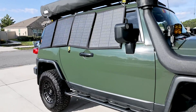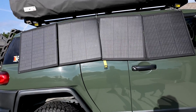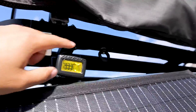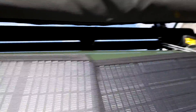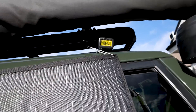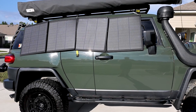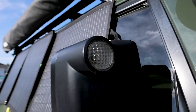In case you don't want to put your solar panel on the ground — it may be very wet, dirty, bad conditions, or not very flat — this is an option: I use some zip ties to my Big Country 4x4 roof rack, connecting to the bottle opener and eye bolts on the bottom track. I used one right there, just connecting some cheap zip ties. Carabiners would look a lot better but this is super easy and costs like pennies. That way I can lift the solar panel off the ground and have it on my roof rack. When the sun changes I'll cut those and put it on top of the roof rack. I ran the cable through the window and I'll show you how much power we're getting.